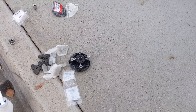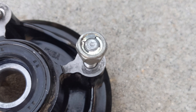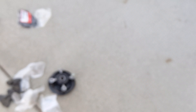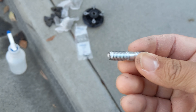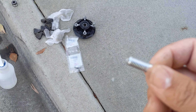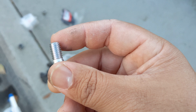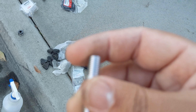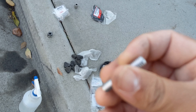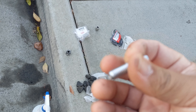These are the dampers I'm gonna replace — pretty straightforward. The nut for the sprocket on the rear, and then the studs. Good time to check your wheel bearing for any play — if that fails, that's gonna be a very bad issue, so make sure you check all that. I'm gonna clean all this up with some kerosene, put the dampers back in. I'll probably record just to show an example of how to do one of the studs.